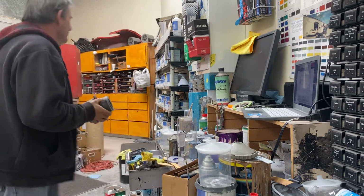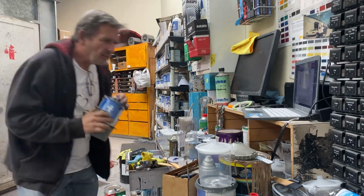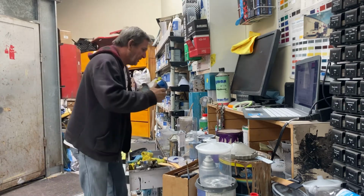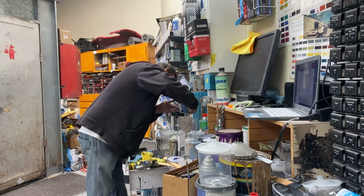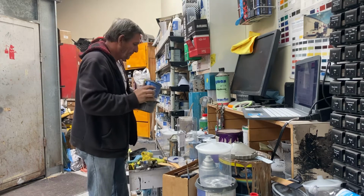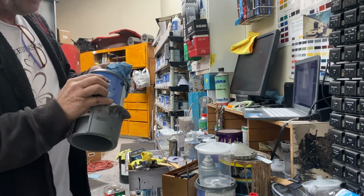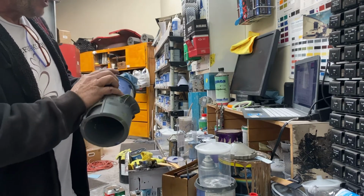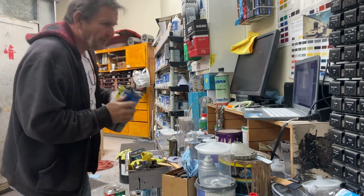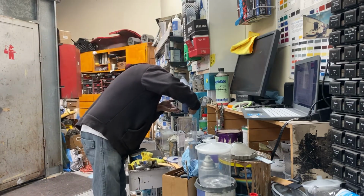All right, now bright blue, 934 is Formula 934 toner, which is this. And they want 0.5. 0.5, so that would take that to 2.0. Reset the scale. So the reason I reset the scale all the time is just so I can see how bad I overpoured, if I did overpour. But since I'm at 1.5, the math of adding 0.5 would take it to 2.0. So I don't have to bump the scale and wait for it to calibrate. I can just go from 1.5 to 2.0. No, I'm there.